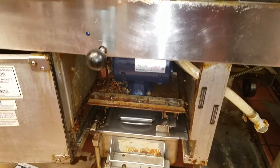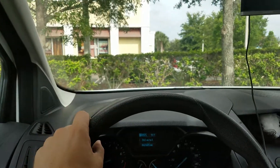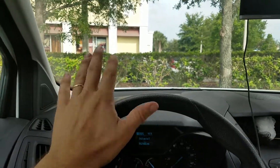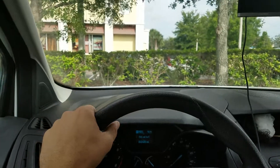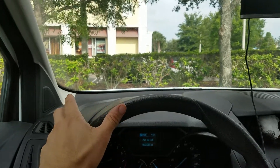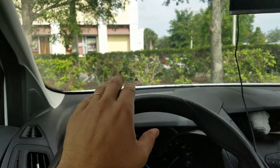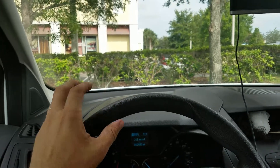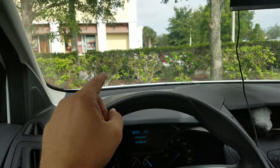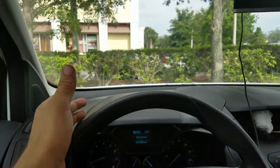That's it, guys — I'm done. I'm going to go ahead and get it all wrapped up, cleaned up, and out of here. I know it's going to be a bit of a long video and I apologize, but this one is a little more mechanical and technical than some other fryers. What we dealt with today: the seal kit leaked oil into the motor, the bearing seized up the motor, so we had to change the motor, change the seal kit, and change the rollers because they were starting to have flat spots, which affects the suction of the pump and makes it less efficient.